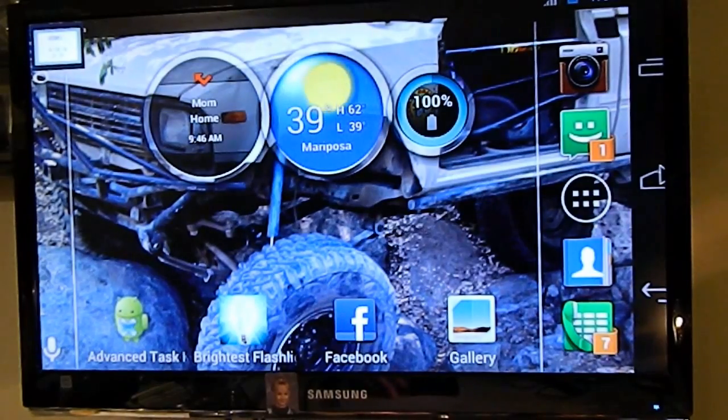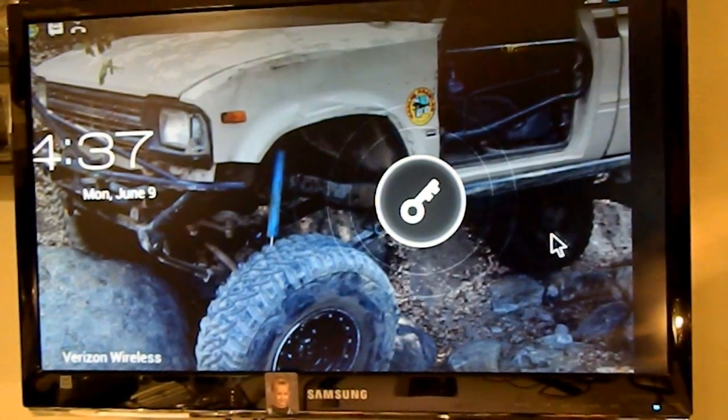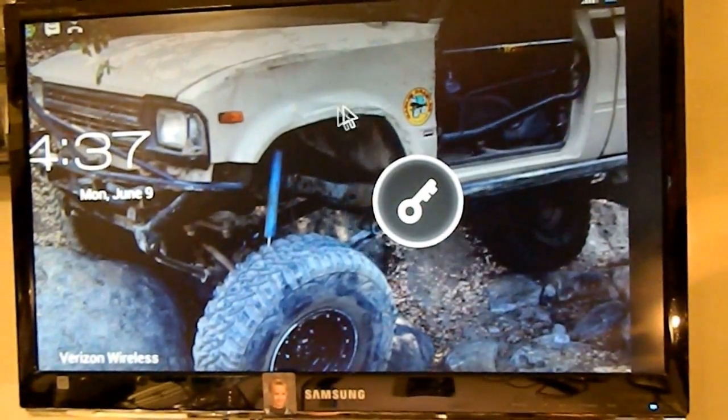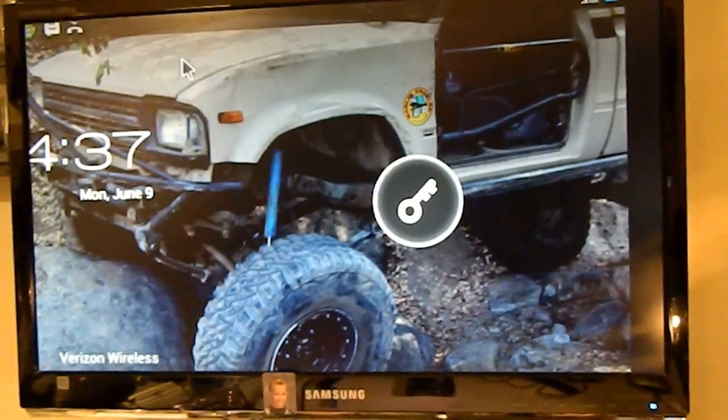When you first start off you're going to hit the power button and what you're going to get is a lock screen. Now you can see the mouse here — it works just like your finger, so it's a little different and you'll have to get used to it, but you can actually use the mouse like you would your finger. Otherwise you could not get into this phone; the phone would not hook up to your computer. Verizon will tell you your stuff is lost and you're not going to be able to get it off. Well, if you have an HDMI port and a charge port on your phone, this is how you get it off.